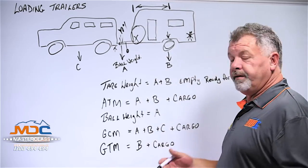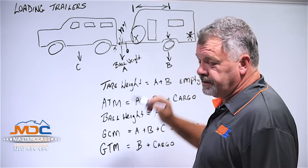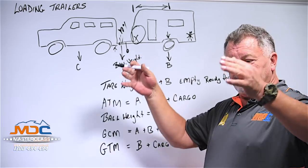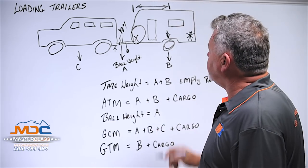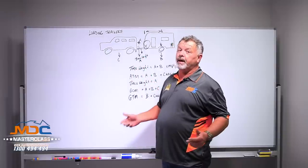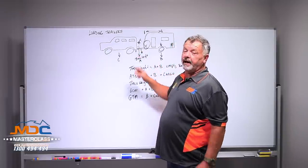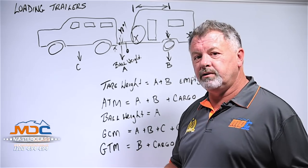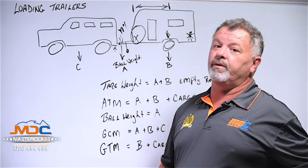With camper trailers, often they'll come with a rack which sits bang smack over the axles — great place to load that extra weight. That's why we put tinnies and boats etc. right there. That's where it's going to have the least effect on the handling of the trailer. What you can do is grab yourself a ball weight scale — you can pick them up at Repco or Super Cheap for as little as a hundred dollars. Place that underneath the coupling and it'll tell you exactly what download you have on the ball, giving you a really good indication if you're in the ballpark for safe handling. Very worthwhile investment.